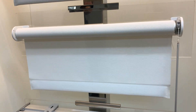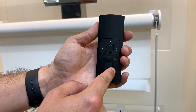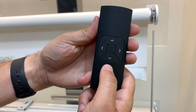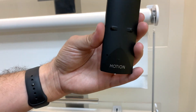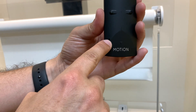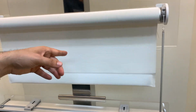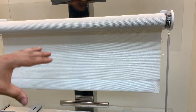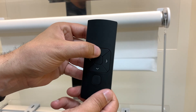Now the first thing we're going to want to do is set up this shade to our remote. I'm going to use a five-channel remote, but all the steps work with other remotes too. I want to put this shade on channel one — one red light up here means it's channel one. I'm going to go to the back of the remote and use a paper clip or something similar. You're going to see a small hole on the bottom of the remote. We're going to do a quick press in that hole. The shade stops jogging for a second and then starts again — when it stopped jogging for a second, that means it took the command and it connected to the remote. Now you can see I can control the shade with this remote.